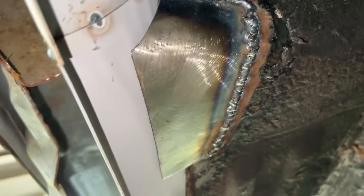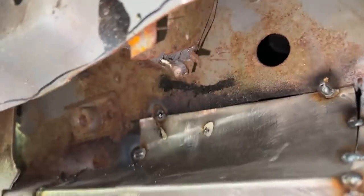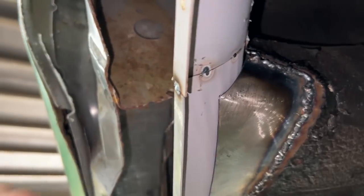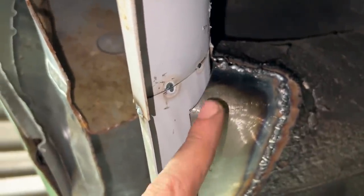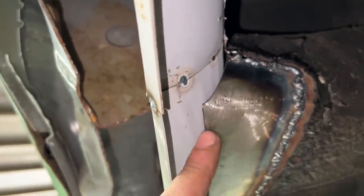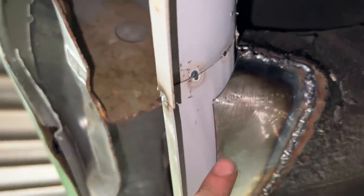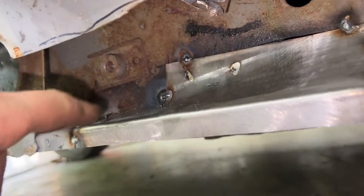This is welded underneath. I welded the inside one, then I welded this one on top of it, then I tucked this one on this side. I painted everything inside with truck bed liner, but now we're gonna burn it wherever we weld here. Now we can weld it here and here. First I'm gonna make a tuck, then hammer and push this up, because now it's springing back. Once you make a tuck somewhere, then you can push the other one up. I'm gonna weld it all over here and then Nick is gonna come and weld inside everything.